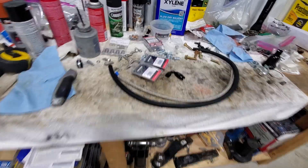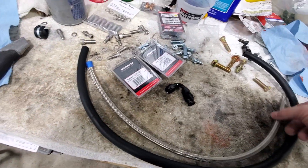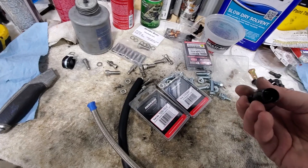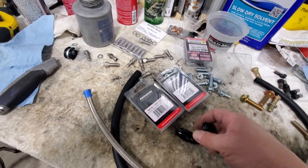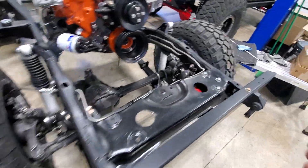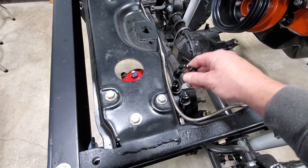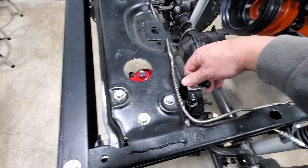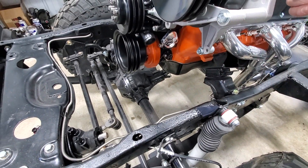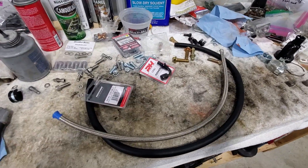Here's what we're going to be using: we've got our rubber push lock hose, and then we've got our braided stainless steel Teflon PTFE hose — this is going to be our high pressure line. These take special fittings, and the PTFE and push lock obviously takes a special fitting as well. I'm using a 120-degree elbow on the steering box, which will allow me to choose my location, bending it down toward the frame. It'll be above the coupler for the steering shaft, then we'll come along the frame, secure it, and bring our hoses up and into the back of the power steering pump.